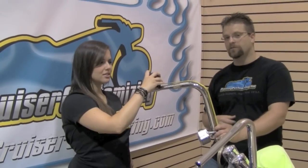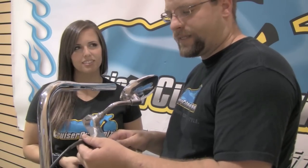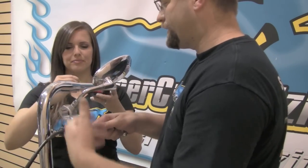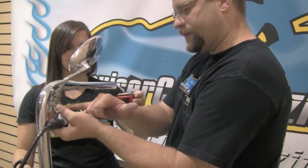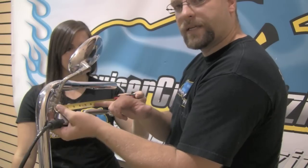Our lines and cables don't get run inside the bar, so that measurement is going to be extremely different. The measurement for lines and cables is a little bit different — you're going to hold it up to where the line or cable extends at its maximum point, then take a tape measure to where it's going to connect. As you can see on this tape, it's roughly six inches over stock. Measuring for the other side is exactly the same, so let's get this bar off the bike and get it wired.